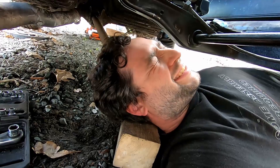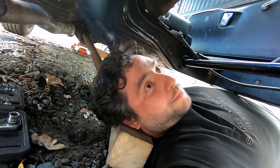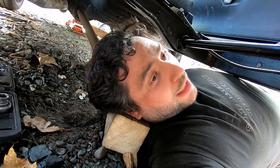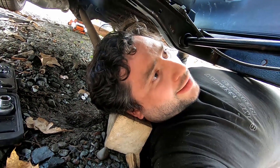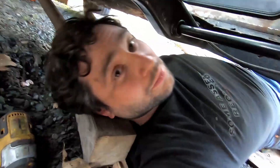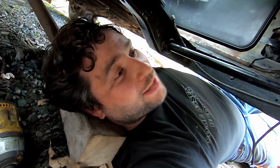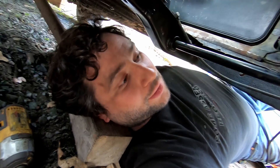I've been under this car a bit too long today, but I'm so excited! The engine isn't in straight right now because I'm holding it up with a ratchet strap until the transmission is set to hold the back up and line her up. She kind of moved to one side when I cinched her down. I don't have the bolts in the engine mounts quite yet just in case I need to quickly pull it back out. But I think we're happy with where everything is. Next step is bell housing. We now have the flywheel, pressure plate, and clutch in there — making great progress! The bell housing is in place; we just have to work on the transmission. Once we have it in, we'll get the floor bolted up and the Z-bar in.